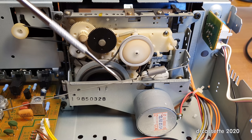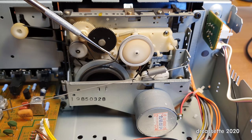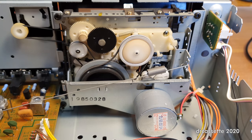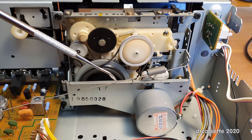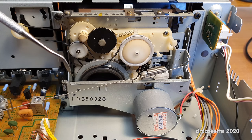This belt, as well as the other hidden belt that connects the motor to the flywheel, are about as loose as they get — these are well on their way to melt and turn into a sticky goo. That is the reason why I did not turn the cassette deck on in the beginning, because the risk is: if these belts are almost molten and you turn on the cassette deck, the motor starts running and it violently rips apart the half-molten belt, leaving bits of half-molten rubber all over your mechanism. I have had that before and I don't need a repeat of that.